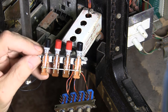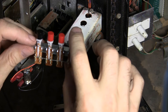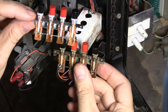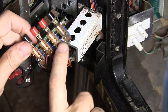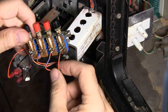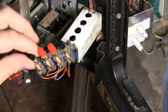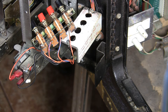You'll get much more reliability out of it. I'm going to solder first — solder the middle links so they're all connected together — and then I'll pull the wires off here and go one by one down on the bottom appropriately. Sometimes if a button doesn't work, the most common thing is one of these wires breaks off. So if you have a button that doesn't work in the cabinet, before you even start to do this, look and see if there's a loose wire and check that first. These things do commonly fail — they're right underneath the lockdown bar, which is where drinks and stuff end up getting spilled — so it's not unusual for them to go bad.